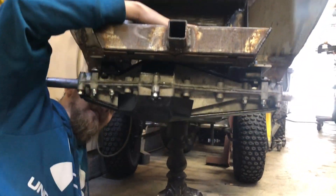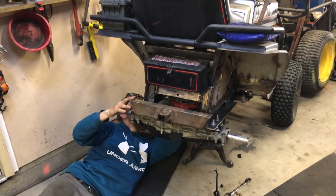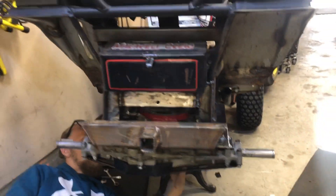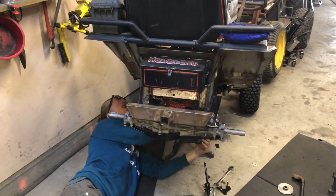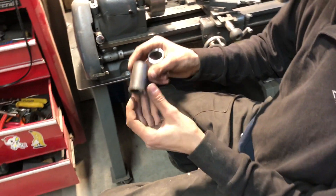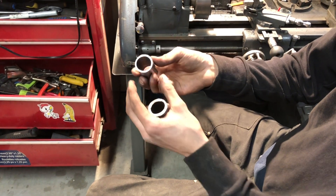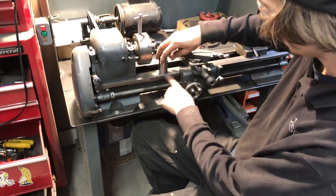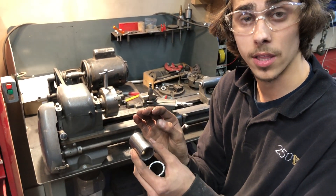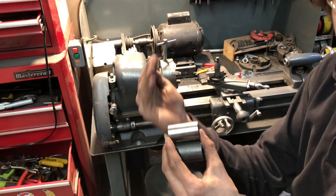Look at that — skid plates are in. Nick's in, I'm in here, we got this almost all welded up. Don't touch the red guard, you will cut your finger off — safety red. Starting with just a raw inch-and-a-half metal with close to an inch ID, this is going to go on the outside of the axle shaft. This is one that's been roughly cut, and this is one once I throw it in the lathe, laid it down nice and straight, so I'll put that inside the hub from the wheel.